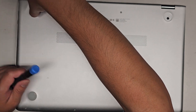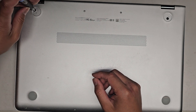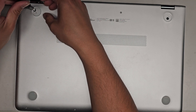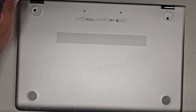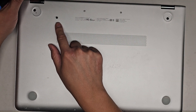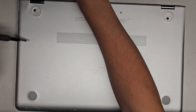First thing, we're going to remove the rubber feet. Both sides have hidden screws, so we're going to undo these PH1 screws. You want to keep them in order because they can be different sizes, shapes, and lengths. The screw is kind of staying in there — let me try with a magnet. It does come out. The way I keep screws in order is I put them flat side down on my desk in the pattern where I removed them.